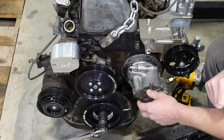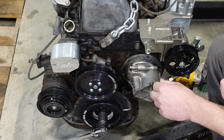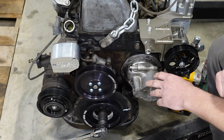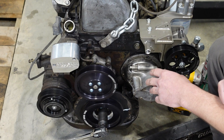So if clocking the pump doesn't work for you, then you might need to delete it. Another reason for deleting it might be because you just don't like the fact that when this vacuum pump fails, it could release a bunch of ball bearings into the engine, which could cause catastrophic engine failure.